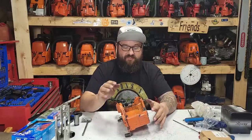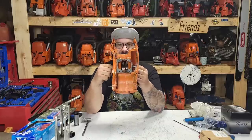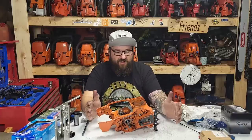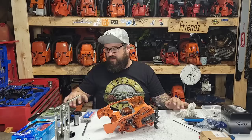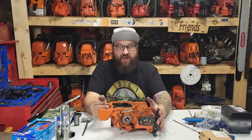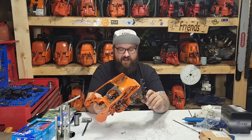What we're going to do today is split this crankcase, replace the bearings. I probably will swap the seals — I know these are new seals, and one way you can tell good seals is they're very tight. But when you heat a crankcase up as hot as you heat these to get the bearing to let go, you can melt the crank seal. So be aware of that. If you buy the Highway set, it comes with the seals and you're good to go.